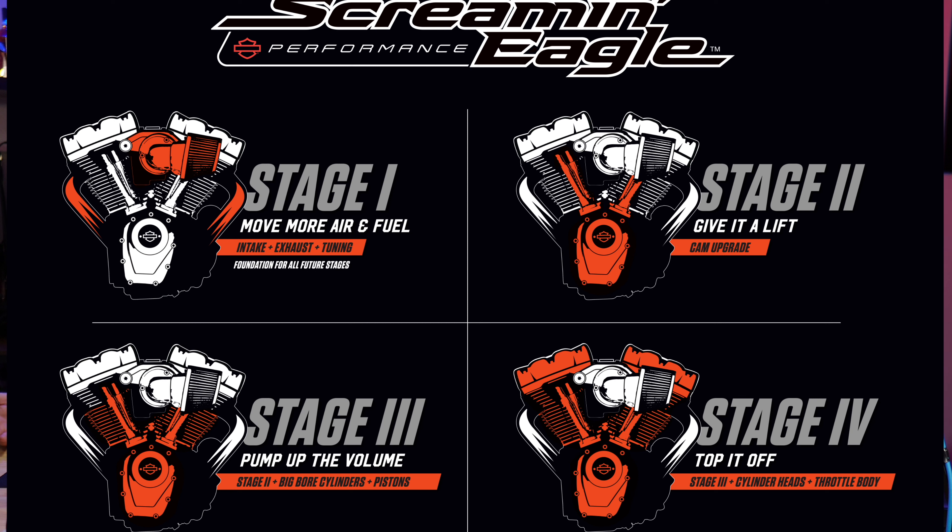After stage two, you move on to stage three — big bore cylinders and pistons. That's basically opening up the cylinder more; your pistons change, you get new rings and new pistons, and that changes how much more air you can have in your cylinders by boring it out. With this kind of work you're getting into labor costs — you could do it yourself if you know what you're doing, but most likely you'll need a machine shop because they have to bore out the cylinders to match the piston and ring size. You definitely need someone with a machine shop to do that type of work.